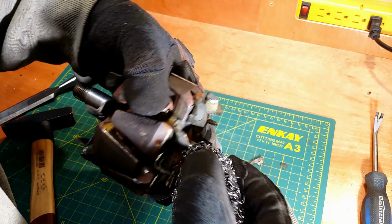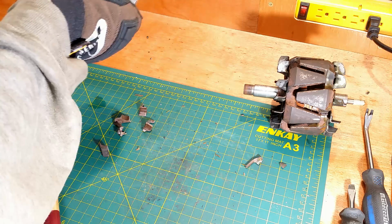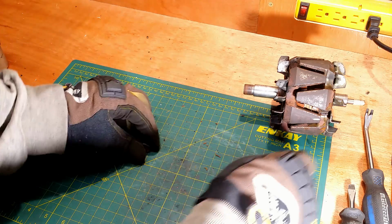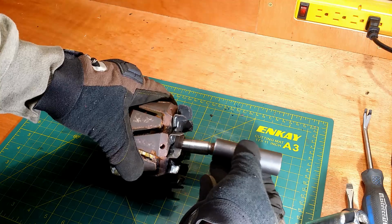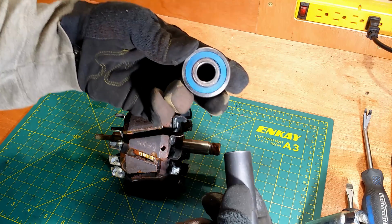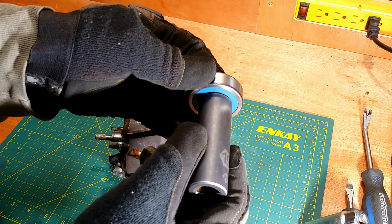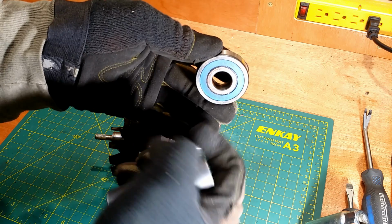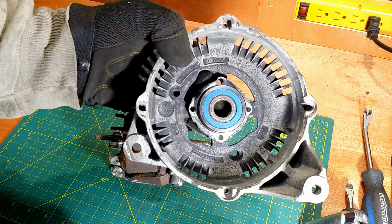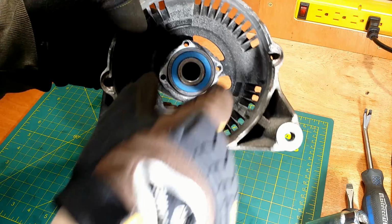Cleaning the shaft. Cleaning the mess. This long socket is big and long enough not to damage the shaft. It is also tiny enough to drive the inner ring of the bearing while pushing it onto the shaft. We must push on the inner race of the bearing, pressing it on a shaft. Pressing the bearing into the housing, we must not press on the inner race. Press the outer bearing ring in this case.